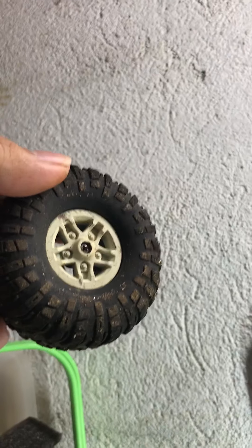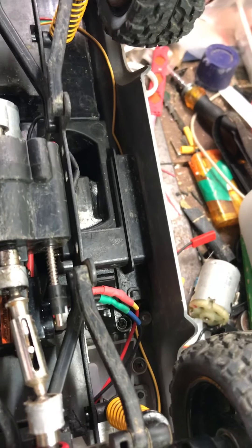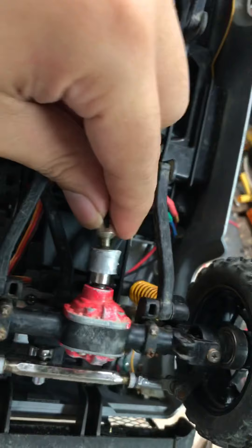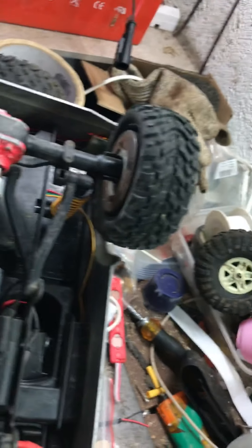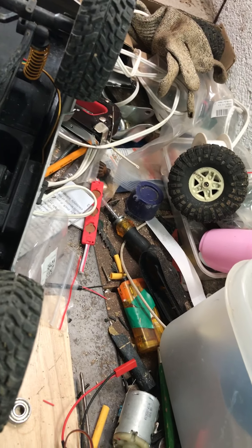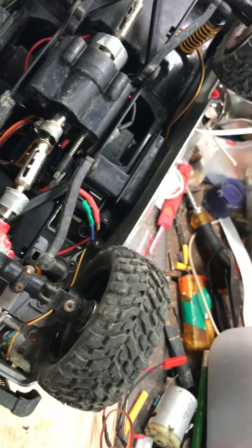But that's rotational weight, and you don't want that — especially if you have an MN or WPL drivetrain. It's not very robust; you're relying on 3mm driveshafts and tiny brass pinion and ring gears that are known to be loose and wiggle around. Putting a lot more rotational weight will really strain that drivetrain.